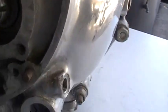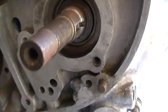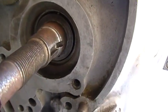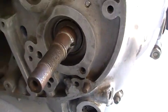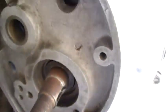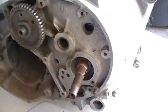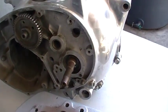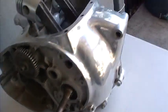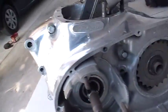and again it's a roller or ball in there with the crank modified for a quill, as I did, we showed you with the other Norton crank. And I just like to use the ball. You might be able to see that bit of steel overlap on the housing in there, and then I put a groove around the inner housing. It gets a groove machined in there for the oil to go around the bearing case, or the bearing sleeve. Again, it's just a typical roller bearing in that side.